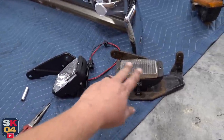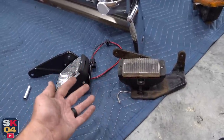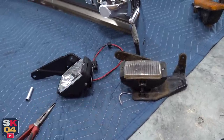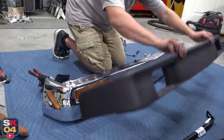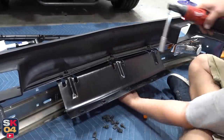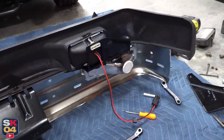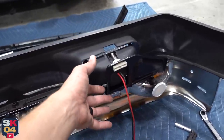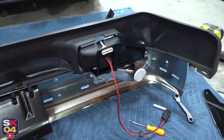The housings are the same — this one's all rusted up and disgusting. So I'm going to take the housing off of this one, put it on this one, and clean up the bracket. It'll work out nice. That fog light worked out quite nicely. I stripped down and repainted that factory bracket so everything fits exactly like it should. I swapped over the bucket from the aftermarket replacement. All of the hardware carried over. Now I'm going to show you how I did it on the other side.